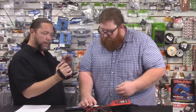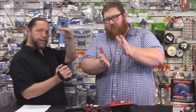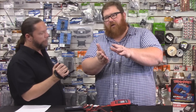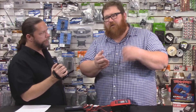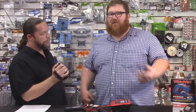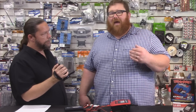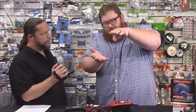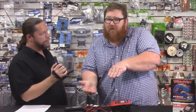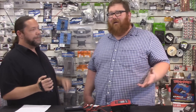What's going on inside a LiPo? You've got separate cells — in a 2S battery, two different cells sandwiched on top of each other. The cells discharge at a slightly different rate. After two or three charges without balancing, you'll have one cell that's always lagging behind. With LiPos, you cannot drain them too far or your charger will not charge them and it damages the chemistry inside the battery. Eventually that lagging cell will go below the minimum voltage and now you've got a dead battery because you refused to balance it.